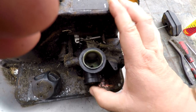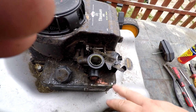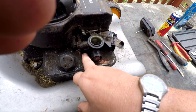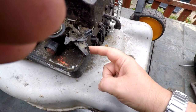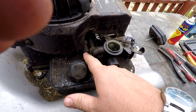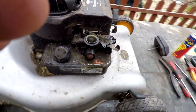This one's been bent a little bit but we'll go with that for now. We know we've got push-to-prime and fuel is going through, so we haven't got a problem with the primer bulb. Our problem seems to be with the diaphragm and gasket which sits underneath the carb, bolted to the fuel tank. There are two bolts to undo - one at the front which is 10mm, 3/8, or 13mm, depending on your mower. Let's take those two screws out and get the carb off.